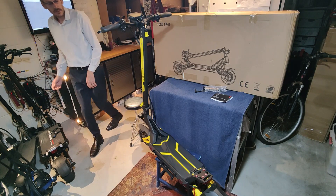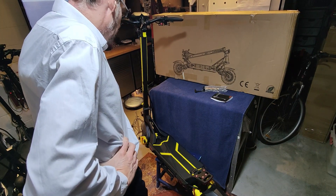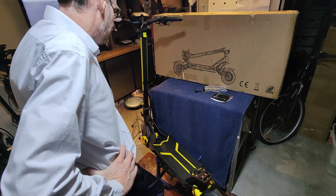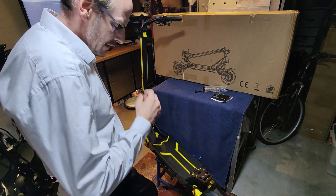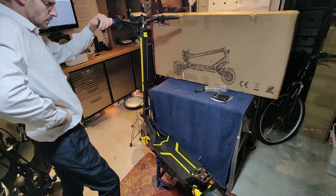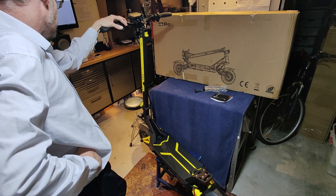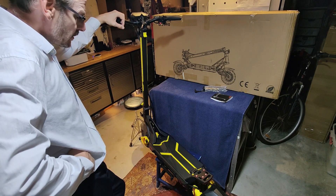There's a 25 ampere controller version, a smaller controller paired with smaller 20 ampere hour Chinese batteries since they can't sustain much more than that. Some 23 to 25 ampere hour ones are normally 25 amp but can potentially be upgraded to 30 amp. A lot of sellers don't really tell you what controllers they're using, but I'm pretty sure these motors do both 52 volt and 60 volt.